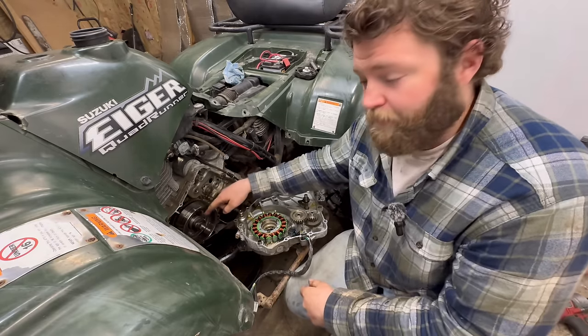I'm going to go ahead and remove the sump cover as well. And I'm glad I did - look at all the junk in that sump filter. There's a lot of oil flow being blocked off in there. I think a lot of this debris is from that magneto side cover when they did that job. It's not silicone - it is hard stuff, some type of sealer. That is why you do not want to use a lot of excess stuff like that. I feel bad for that oil pump - I bet it was working hard to push all that oil through that crap.